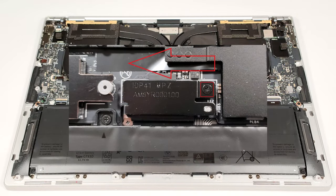There is a bracket on top of the battery connector that is held in place with one Phillips head screw. Undo it, slide the metal cap to the left and lift it away from the base. Don't forget to use gloves to avoid short circuits.